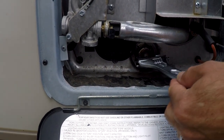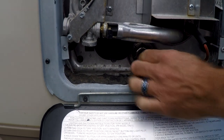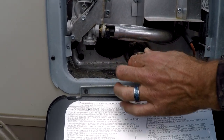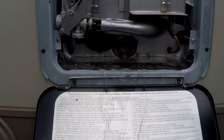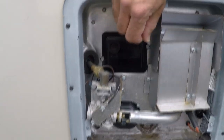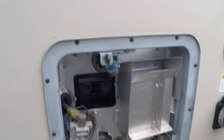Then you want to come outside and take this nut off right here. Before you do this, you want to make sure that you've opened your hot water drain just to take the pressure off the inside. You'll notice there is a rod attached to it — what this does is, instead of corroding the inside of the tank, it'll corrode that rod. You can see the water coming out. Now I'm taking the pressure relief valve and pulling it open so it'll come out even faster — let the air out.